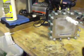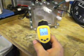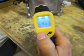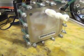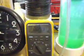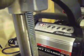I want to go over a few of the parameters before I start the test. Temperature is extremely important. Currently the cell is running at 46 Celsius, which is 115 degrees Fahrenheit — fairly cool. It's been running for about an hour to an hour and a half. We're running at just about 10 amps: 9.9 amps on my inductive amp-meter, and my battery charger reads 10.1.